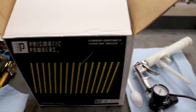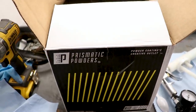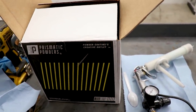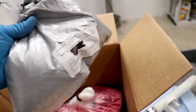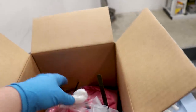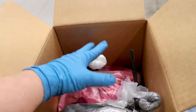And for powder, I'm using Prismatic - best powder in the game in my opinion. Powder plays a huge role in how well your project comes out, so you better choose wisely. The color we're going with on these hubs is a red, so it's going to be like an anodized look. So basically, we use a chrome base and then a red translucent or red transparent color over the chrome. And that's how you achieve the anodized look with powder coating. So like I said, the first coat is the chrome - it's actually a really cool look in itself, but you have to put some sort of coating over it, whether that's a clear coat or like a color in this situation.